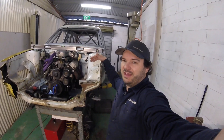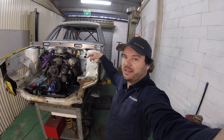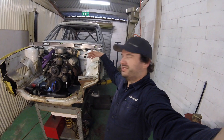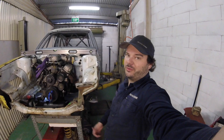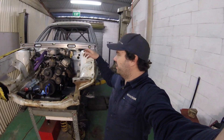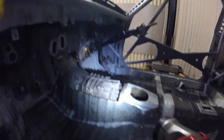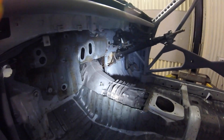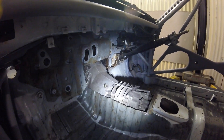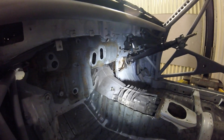A big goal of what I would like to do with this motor is to set the weight back as far as possible. So we did modify the cross member there - a good 50mm, that was enough. That was as much as I'd like to cut out without feeling like I've cut too much out, because these are the mounts here for the steering rack. I didn't want to start playing with steering rack locations and all those sorts of things. But I really think that effort put in now to push the motor back is just going to really help the car drive that little bit nicer. I didn't want a big lump of iron out in front of my steering wheels - I wanted everything as far back as we could. We cut more of the trans tunnel out to clear the gearbox, so we have made a reasonably big hole now to fit that gearbox with just how far back I wanted to come. Either way, that was getting cut, so a little bit more of a cut isn't really an issue.